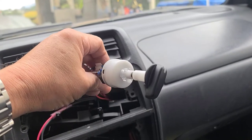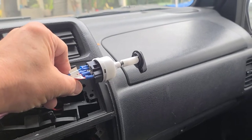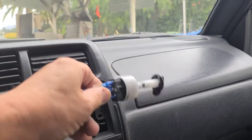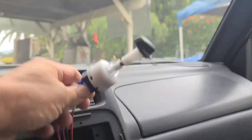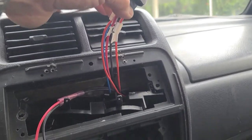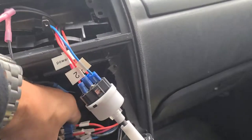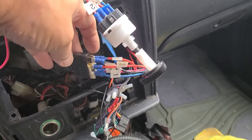This is a generic — well, it's for a Mazda. It's a four-position fan switch, which means it has five plugs: one for power and four for four different speeds. I have it wired and coded also. And then I've brought it down to where my fan switch formerly connected, down here.